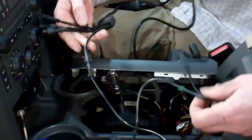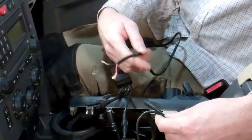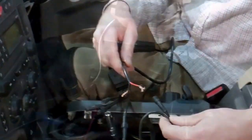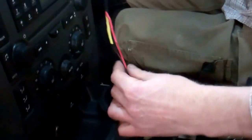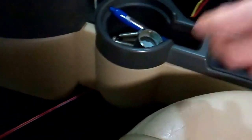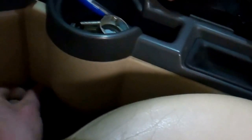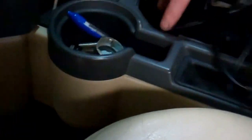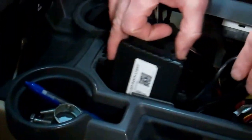Get all four connectors clipped up. Then we've got to connect the wires here to the interior light. The control box is in and we've extended it — we've added about a metre of extra cable. Pull that through out the bottom, and then the module tucks in — there's loads of room under there. Tuck all the wires down where we've drilled our hole.